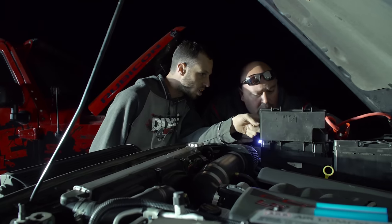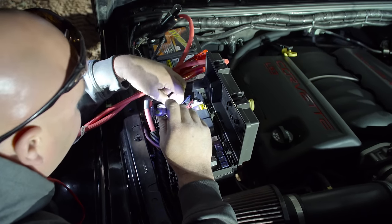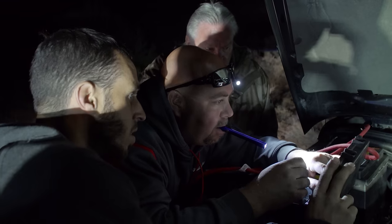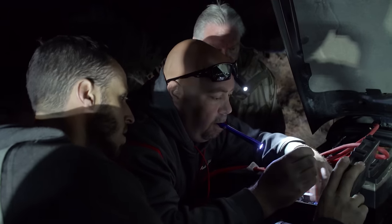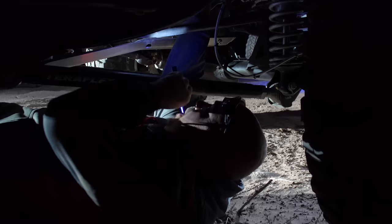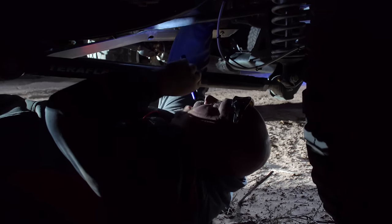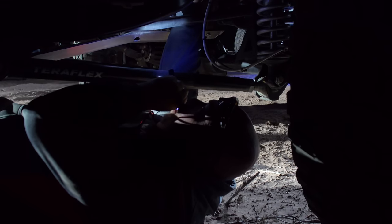When we opened his doors the electric step comes down, he's got battery power, lights are on, no start. So we lift the hood, pull the fuse, start checking — fuses are all good. Start chasing the wiring harness and find that one of the leads wasn't connected to the starter. We touched it, fired it up, fixed it within 10 minutes and we were ready to go.